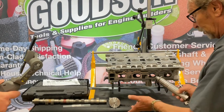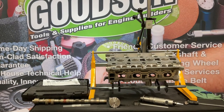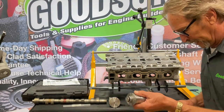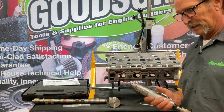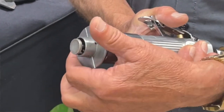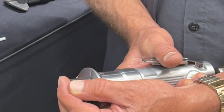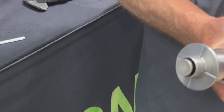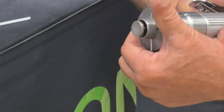It's very simple: we get our tool set up here, we hook it up to air — hang on, I forgot the air hose. Details, details — no prop man here, I'm supposed to do it all myself. Got my die grinder set up and going. I put it right on the top — this is square, 90 degrees. I dial in two thousandths and take that off. I dial in another two thousandths and remove that. Remember, I'm trying to get to six thousandths, so two more thousandths.